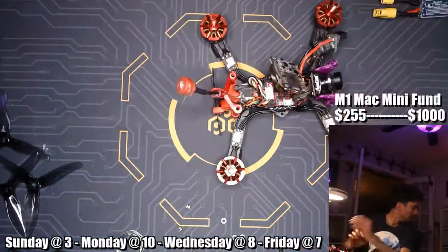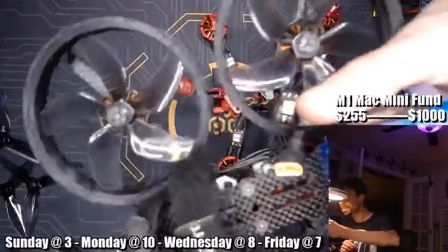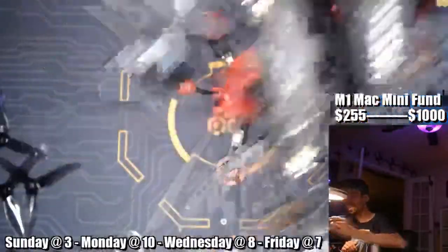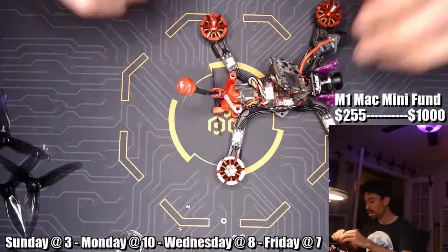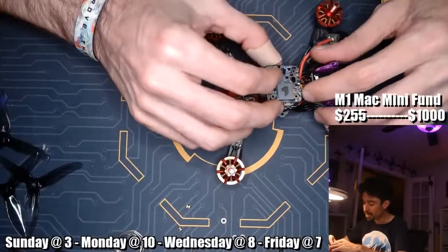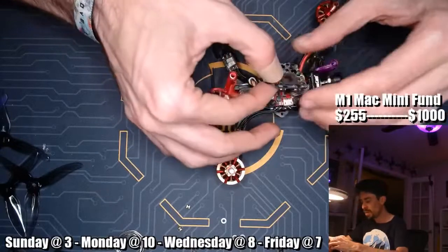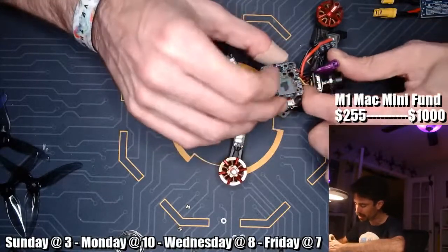And I think it's got a big ESC in it now. Let me see real quick. Did I put the 5-inch ESC in there? Oh yeah, this is that Ori 32, 5-inch ESC. Both of them have big gnarly ESCs in them now, so I can bang the shit out of them, and I can run them on 5S. They'll have all the power in the world on 5S. Christ, I can even do them on 6S, come to think of it.